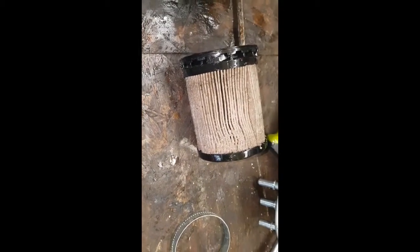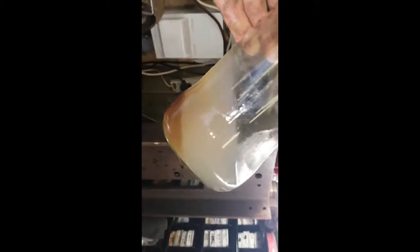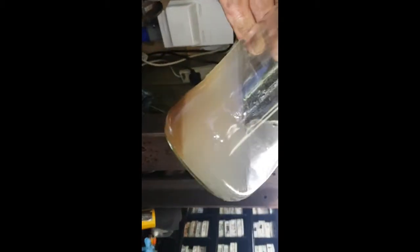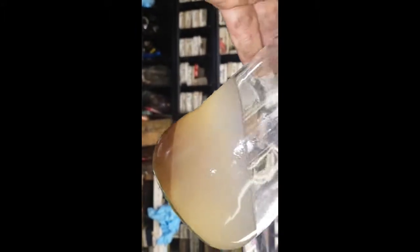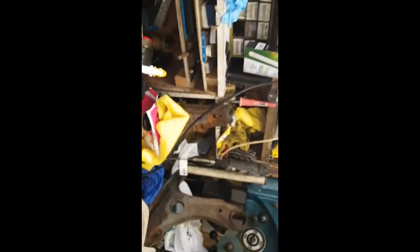I'm not seeing metal filings — I've gone through all the folds. I'm just going to change the filter and see if it fires up, because I've drained some more out. Basically draining the actual filter itself, the paper elements, and more of this shit has come out. There's probably more to be squeezed out of there but there's no point really. So let's hope it's as simple as a filter change.